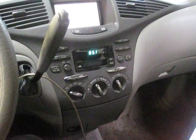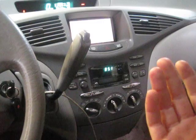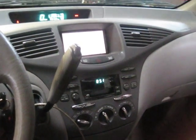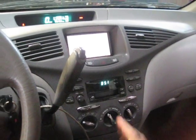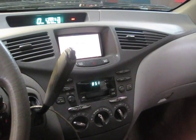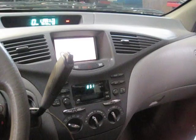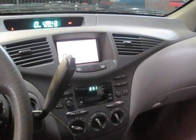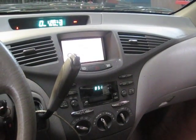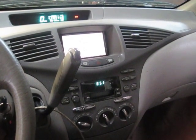There are times when the leak is intermittent, which is typically because it's inside the battery. There will be times when it won't set right away, and if the code doesn't set right away in each of these stages, then there's no way to say for sure where it's coming from. It has to be predictable and reproducible. So we're at 8:51. I'm obviously going over 60 seconds, but then I know for sure that I've at least covered one minute.